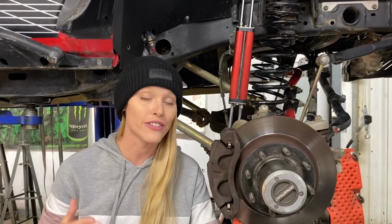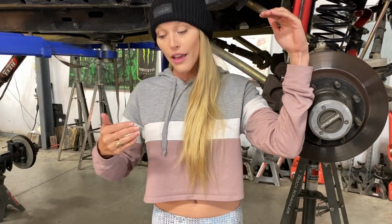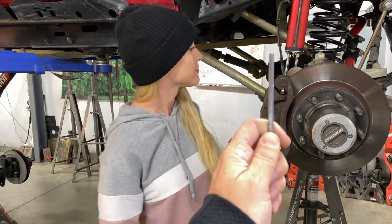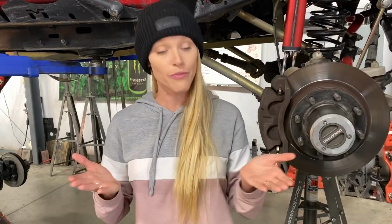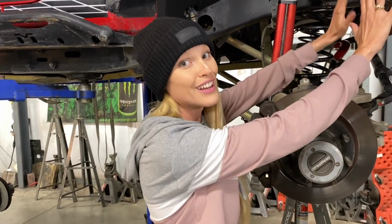So now what that means in terms of off-roading, if you're thinking about rock crawling and you have one wheel way up here and you have one wheel drooped way down here, the wheel that's drooped down here has swung backwards and you get axle steer as you're off-roading, which can affect your stability. Right, and the wheel that's up is actually forward. More forward, because basically as this comes up, this pushes the whole axle forward. So that's what axle steer is, and that's where your short arm kit or your factory mid arm can kind of have a little bit of a flaw.